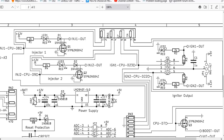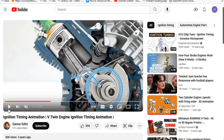So I am going to remove the two LEDs, reinstall new ones, and not push them all the way in the board, leave their legs long, and put heat shrink tubing around their legs. And then after I've soldered them in place, I'm going to physically bend them and swap their places so that this becomes a useful tool, okay? So why do I need these LEDs to be there so that I can see the cylinders individually? Well, I think that goes without saying, but we'll go into it here in just a sec.